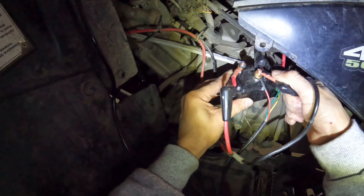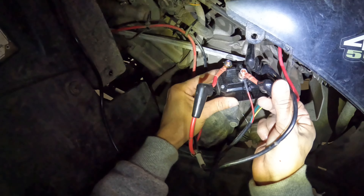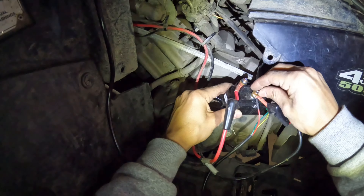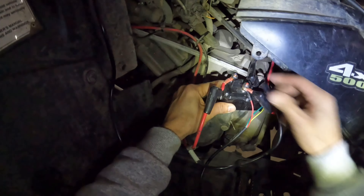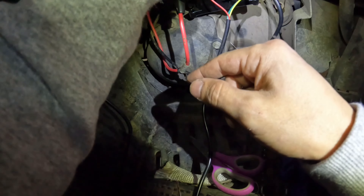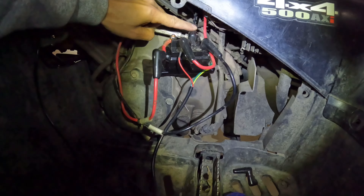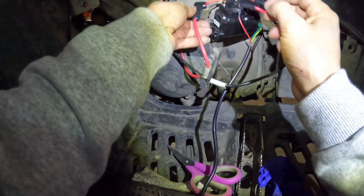Terminals covered. So I'll put that there, shut that down, put that on there. So this is the power wire from the battery — this goes to the battery power. This black one right here is the ground going to the battery. They're both connected. This is the power to the winch, and this one's the ground — or negative — to the winch. It's good to go.